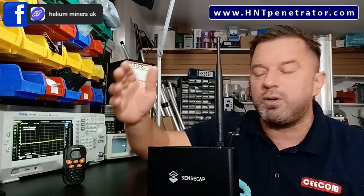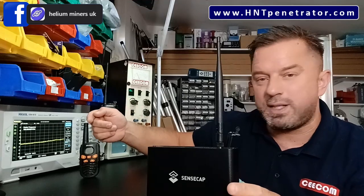Your antenna and hot spot are listening all the time for incoming radio signals. Now, someone else sets up a hot spot nearby. Every now and again that hot spot will send a beacon — it transmits radio waves for just a split second around its antenna, trying to reach as far as possible to give good coverage on the network. So every now and again it says 'Hello, can anyone hear me?' and sends that beacon signal out through the airwaves.